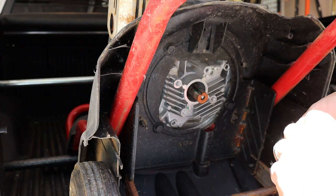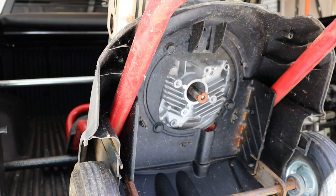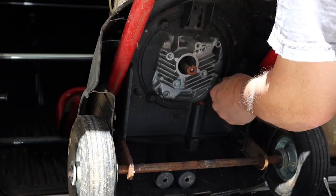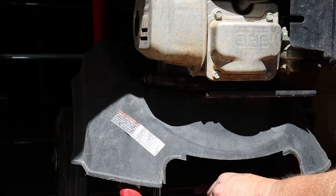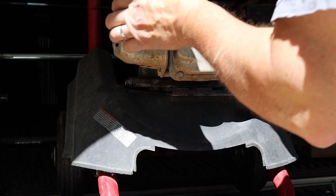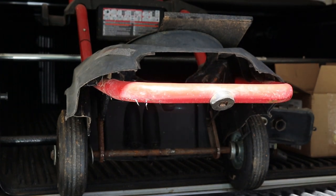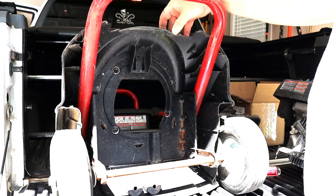Unfortunately the key is molded into that adapter, so we're going to have to have a key. That's okay — I'll leave everything in the description that we need. Now the engine is held on with three bolts. You need a nine-sixteenths socket or wrench. There's one, there's two, and there's three. Check the engine off, set it off to the side. Keep it upright so you don't spill stuff everywhere. I want to get rid of this upper plastic shroud just because I don't like it in my way.